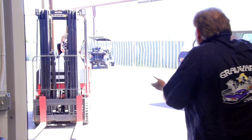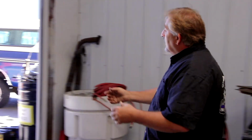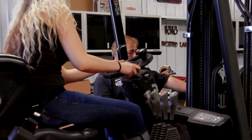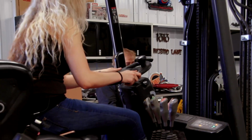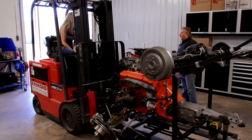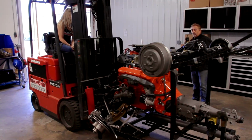Are you done yet? There's a world waiting for you. Sure. You done? And just so you know, it will, at a certain point, because it's crooked, force the engine around to being straight. So don't worry when it scrapes across the floor, because that's what it will do. You're where you need to be, so now you're going to want to turn your wheels to your left, because where we're going with this unit is underneath the shop crane right here.